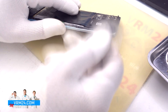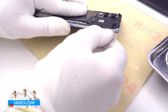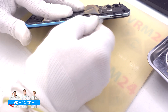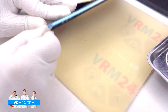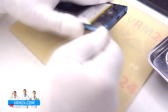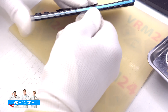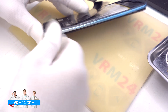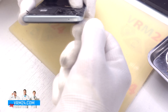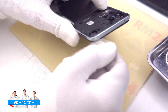And we can start to detach the middle cover. We use thin plastic film, run the film into the hole near the card tray hole and gently run it along to detach the clips. Always be careful in the area of the side buttons, because they are physically located there and cables may be present that can be damaged.